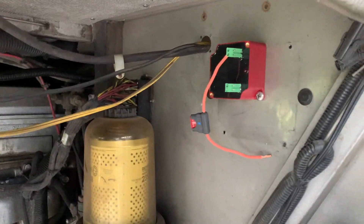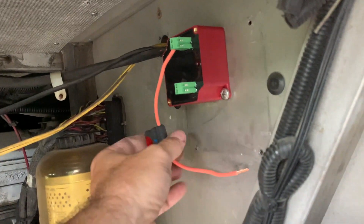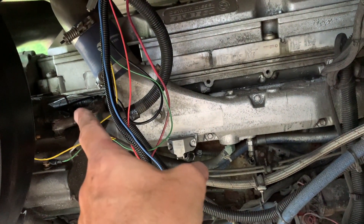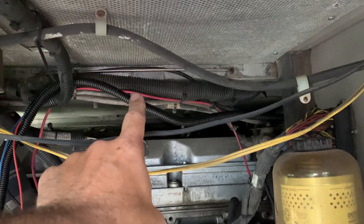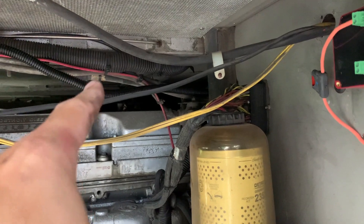The other thing I'm doing is putting in the alternator protector. It's supposed to have a five-amp fuse, so I've got a five-amp fuse and I mounted it right here. I've also got the negative to route back over here and attach to the negative wire. I also have to route a positive wire from here — they want it attached to the positive output and the negative of the alternator, so I've got to take the negative back off and run wire over there.